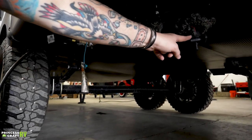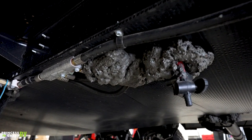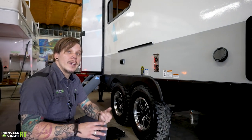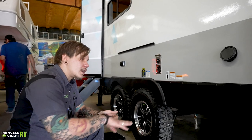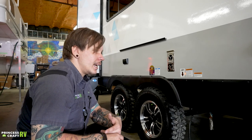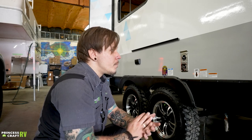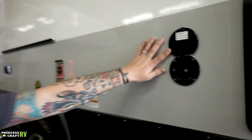Looking at the underside of the camper, we'll see our low-point drains — the lowest point in the unit's plumbing. That is how we drain everything between water source and fixture. We drain those every single time we take the unit into storage for more than seven days. We'll drain the fresh water holding tank only if it's been in use, then come over here and drain the low-point drains, and lastly finish with the water heater, which we'll discuss in just a moment. Those have valves on each line and are gravity feed — just open the valve, give it a few minutes to drain.